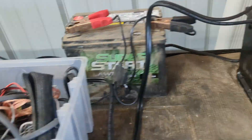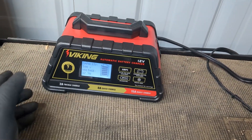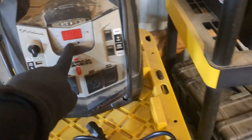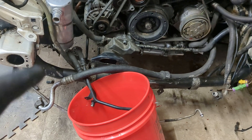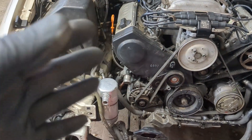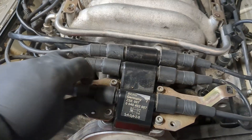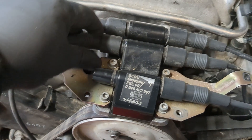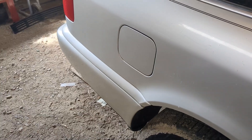Battery wasn't that old. I got soldering stuff out from last night, but the battery wasn't that old, so I just hooked up to this charger. Holding the charge, I reconditioned it. I think what I'll use for the test crank is just this jump pack. I got a bucket in case the trans spins and pumps any fluid out. If all this works and we get it back together, I will do a trans fluid flush and filter change. So I'm just going to pull these now — these are brand new wires, I got them off FCP Euro. There's not much fuel in here, I tried to siphon some out, so we'll see, but let's just see if we can get a crank and then I'll worry about throwing fuel in there.